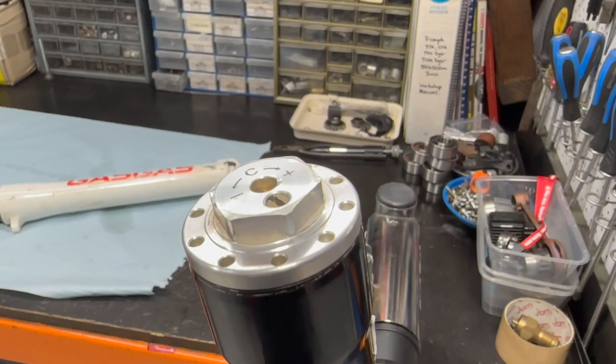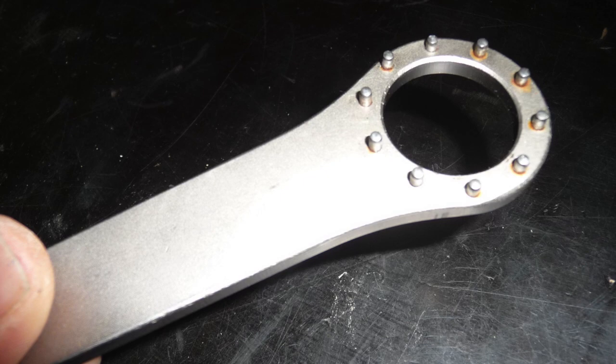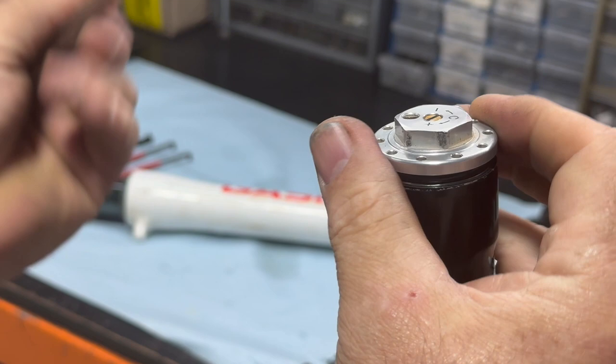Let's start with the top — we need to undo that. We've got some pin spanners and a tool that I made myself. You can use a number of things, but on the left-hand leg you can also use a 22mm shifter because that nut is just for looks. That's the tool that I made to make the job easier for ourselves, but yeah that's going to the extreme because we work on them pretty often. Wind it off and then we can start from here.